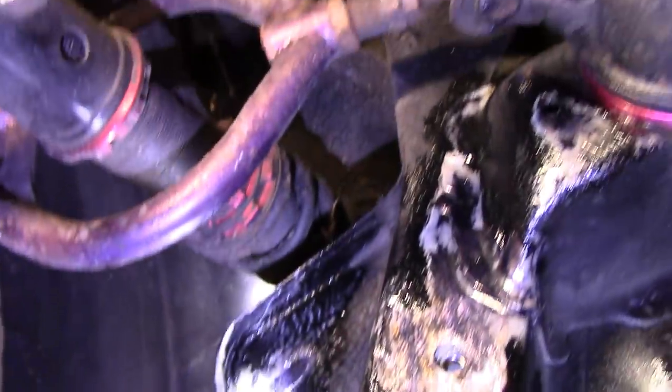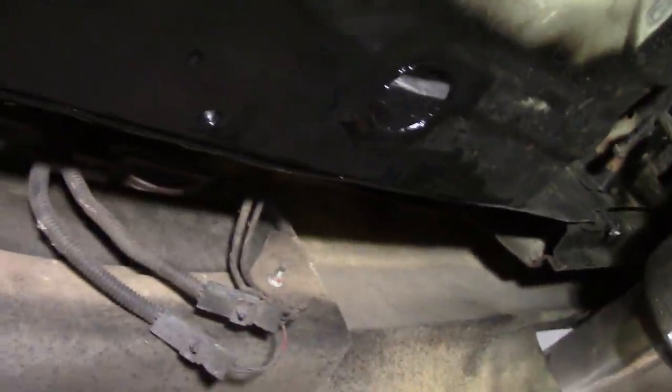So, now done, let's get proper paint on the starboard side. Painting's finished on the rear starboard, two coats of anti-rust converter and then three coats of hammerite. Doesn't look pretty, but it's pretty solid and rust free, which is nice. I've done the best we can. It's quite hard to get into all the nooks and crannies with the power tools, so done the best we can, like the rest of the car, working on your back.